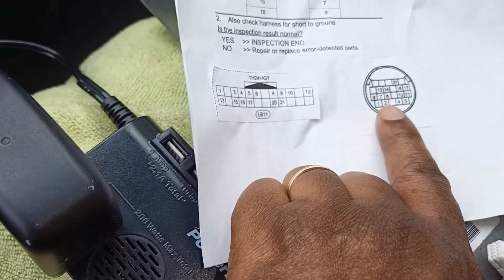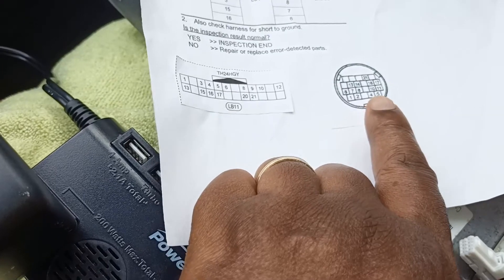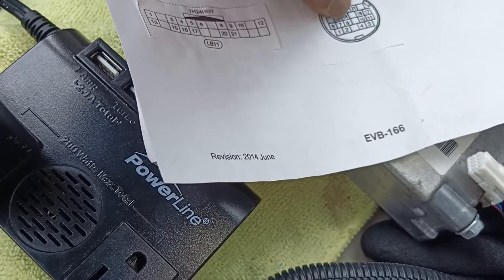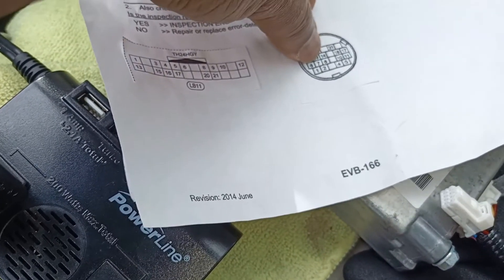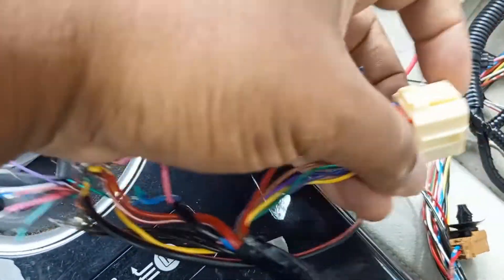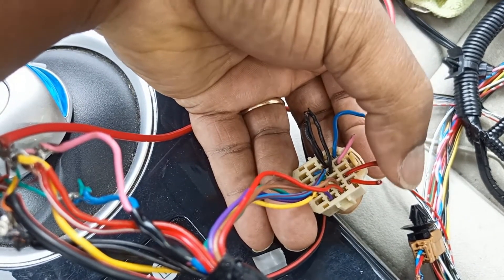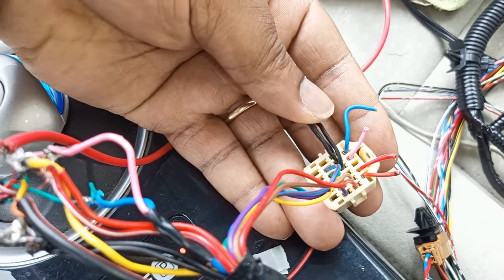At the top of this port, what you need is pins one and two, four and five. And you need your ground - the ground pins are eight, seven, and six. You can see here: CAN high, CAN low, power positive, ignition, charging - and six, seven, and eight are the grounds.